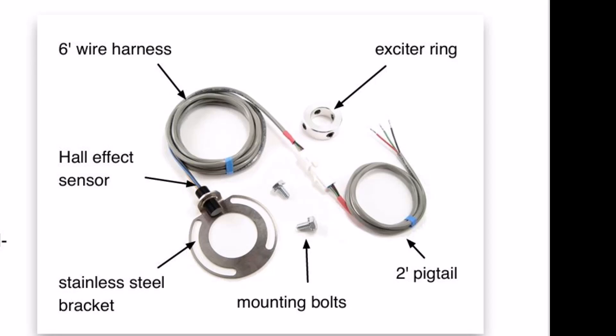So I have two main problems to overcome. One is I lost that item — somewhere between parting out my Spitfire and starting the restoration of my Volkswagen bus, I simply lost it. The only thing I have left is the aluminum exciter ring. The second problem is the motor controller I'm now using doesn't have that feature — the terminals to plug in the speed sensor and translate it to a tachometer output. So I need to figure out what hall effect sensor to use, how to mount it to my Warp 9 motor, and how to translate that output into a pulse my tachometer will recognize.